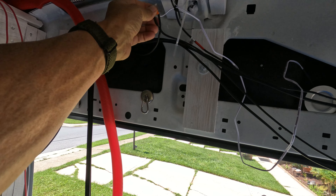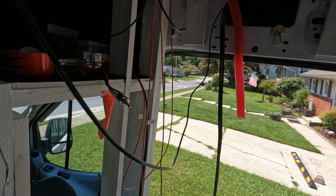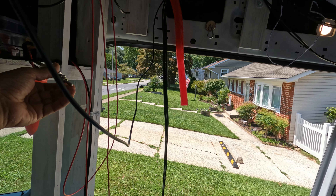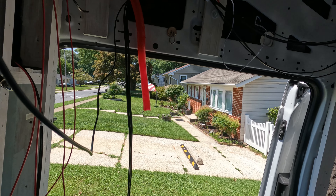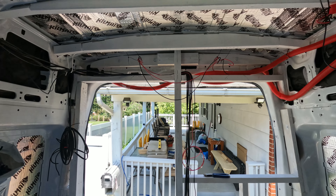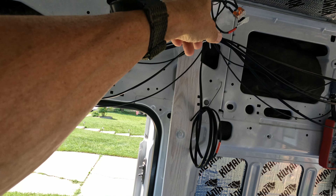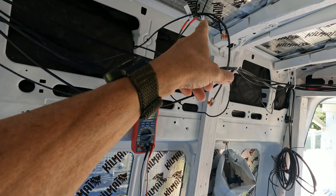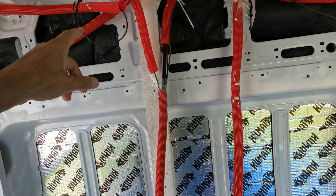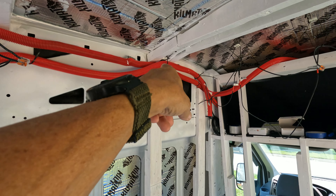These switches are what they call Single Pole Double Throw — SPDT on-on switches. Got one working, nine more to go. That one there is going to be over there, and on the same on-on switch, another one's going to be here, and another one's going to be here. Then in the back there's going to be a light here, a light there, a light there — that's kind of the back bathroom area. And then for the bedroom, light here, there, and over there.